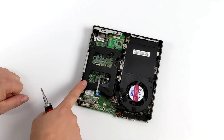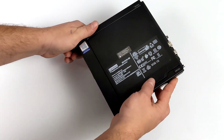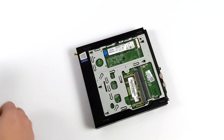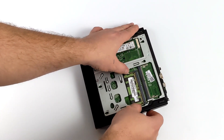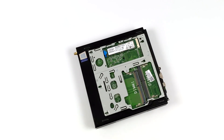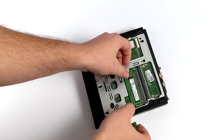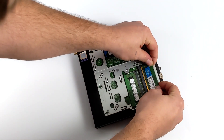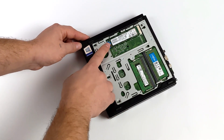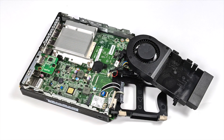Pulling the top off is pretty easy. It does have a spot for a 2.5-inch drive, either mechanical or SSD. Looks like it's got a smaller cooler, but I think they've designed this pretty well — we'll have to see when we get into testing. If we flip this over, we can actually access that M.2 SSD and our RAM slots. This supports dual channel RAM up to 64 gigabytes. I'm going with two 8-gigabyte sticks of Crucial at 3200MHz. So I've upgraded the RAM, and I'm going to leave the SSD as is for now.